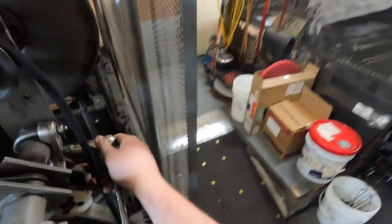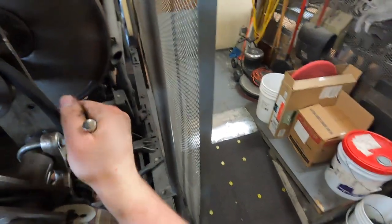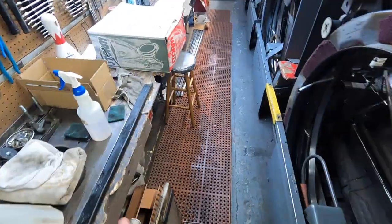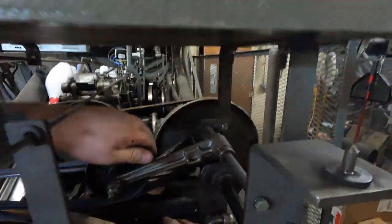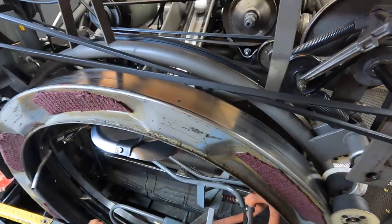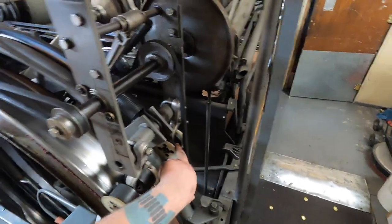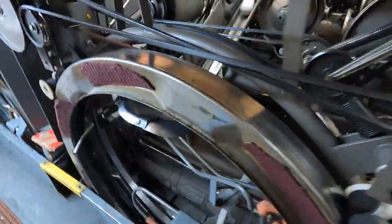And we're back. Now that that's on, go ahead and put that back on. That's it, simple as that. You want to make sure your pinwheel is just touching enough to make contact — you don't want to squeeze it. And then the exact opposite with your ball wheel: you want to make sure that's as close as possible. But before doing that, you want to make sure that you take tension off the belt first. And then you should be good.